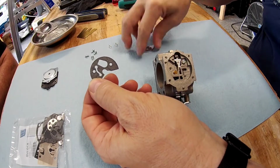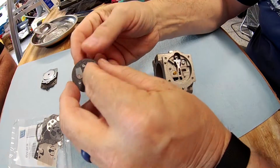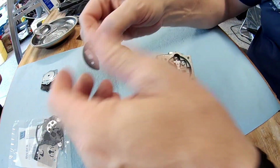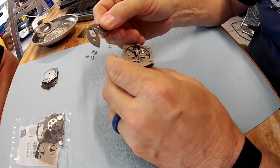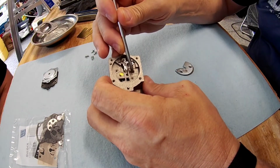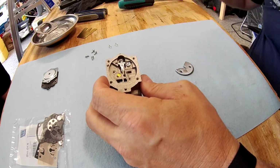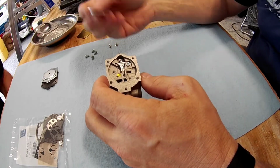And if you don't get the right one on there, then this is actually a channel for fuel between, I want to say right between your low screw and right here. So if you don't have that little channel in there, then guess what? Your fuel's not going to flow. So you're not going to get the right operation out of your carburetor if it even runs at all.